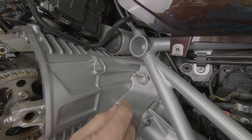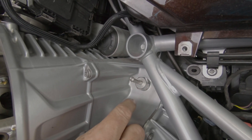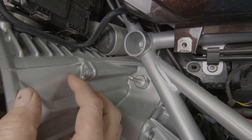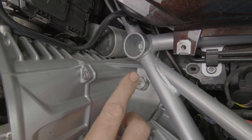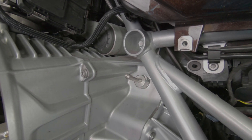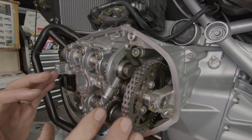The eight millimeter pin will not fall into the six millimeter slot. There's an eight millimeter slot that references top dead center to one cylinder or the other each time it comes around. I just pull it out a little bit so it's not resting on the rotor of the alternator, and now I look at the engine's valve train.